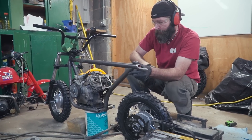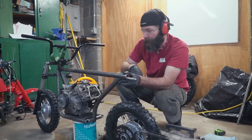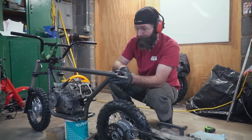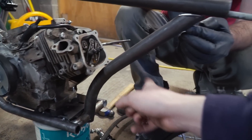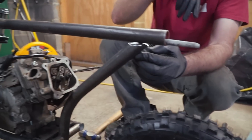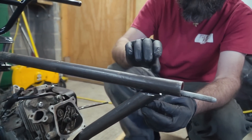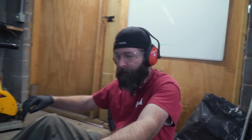That's pretty sweet. We ought to wait until we get our final engine with the valve cover and all that stuff. For suspension, it's going to be difficult to run a single shock now that we have a backbone, so we're thinking shocks on the side like on a Z50, or maybe a cantilevered shock parallel with the upper tube, or shocks mounted lower. We're not sure — we'd like something a little different. We'll wing it. This build is off to an awesome start — it looks like it's going somewhere just sitting still.